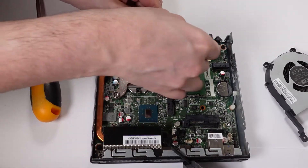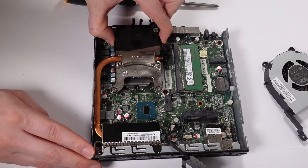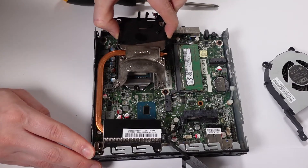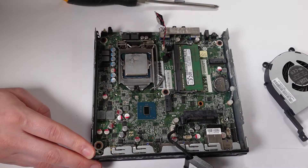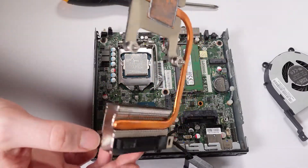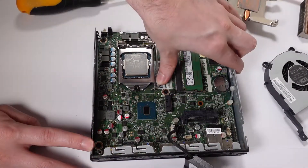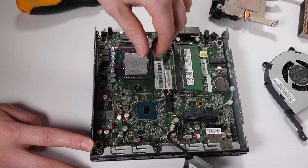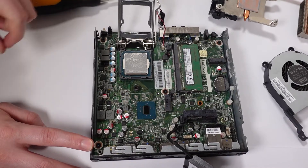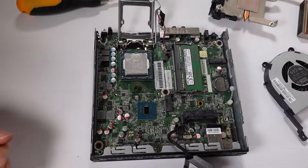I will quickly pop the speaker out. Just a bit of a wiggle and it comes out no problem. Pretty standard affair — bit of copper heat pipe down to a vent and just a blower fan. We have here a standard CPU socket for the Skylake chips. It can't take any capital K (unlocked) chips. So the fastest CPU you can install in this machine is a 6700T. You can modify the BIOS and it can take Kaby Lake CPUs then, but realistically you're limited to a 6700T.